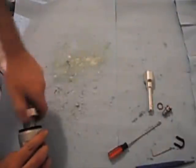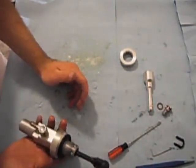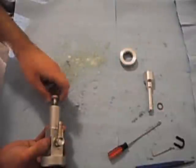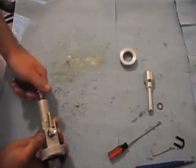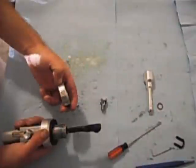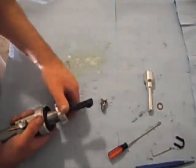Next, we're going to go ahead and show you, if you have purchased the aluminum upgrade arm, the order in which you need to install this. At this point, if you're reusing the plastic arm, this is ready to go into the car. Just attach your clutch line on this end — you're going to reuse your other banjo bolt and the brass washers. Install that into the end of the master assembly. Install your reservoir line here with the hose clamp that's provided. Then install onto the clutch pedal assembly, attach the plastic arm onto the clutch pedal after you slide the ring on. Then torque the ring down with an Allen wrench or screwdriver — whatever you can fit in there to get proper leverage to tighten it up against the clutch pedal.